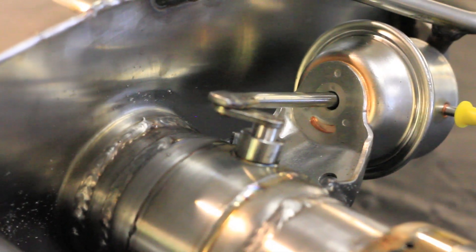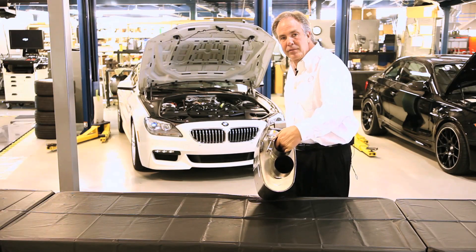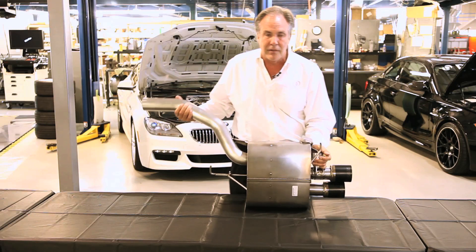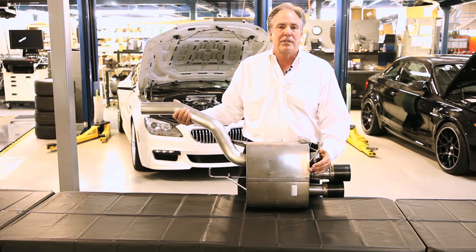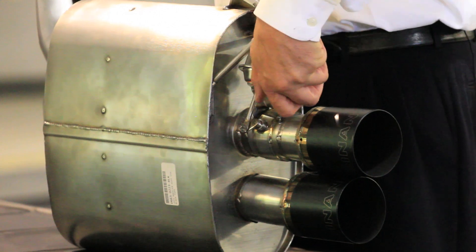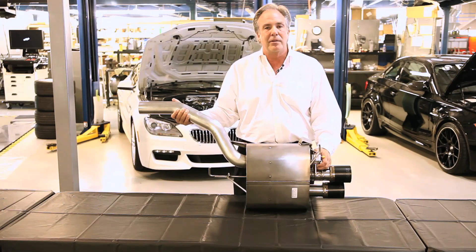We do it with a couple of high-tech things. First, we have this butterfly valve, which actually locks down one half of the exhaust system so air will flow — it's like a throttle for your engine in the exhaust. This is computer controlled off the engine ECU and it's a bigger diameter valve than the one that came on the car, so it will flow more. When you're in turbo boost, the butterfly opens, lets all the exhaust out, lets the noise out, makes it sound sporty, but you don't wind up with any compromise under normal driving conditions.